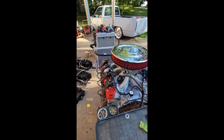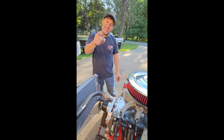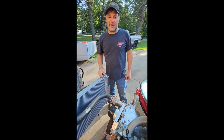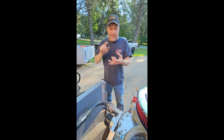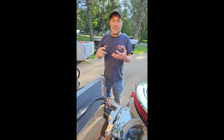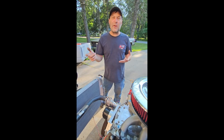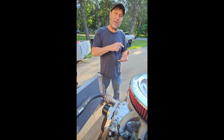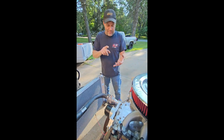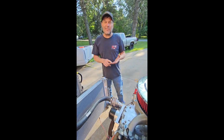And keep in mind, people, the biggest thing I can tell people before you jump into an LS swap: research your vehicle for your particular car. You can find out what oil pan fits, what front drive accessories fit, what intake fits under your hood. If you do all that, a motor out of a newer Camaro would be a better choice than finding a truck motor that came cheaper, but you couldn't use the intake manifold, the front drive accessories, the oil pump or the oil pan and everything as well.